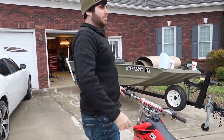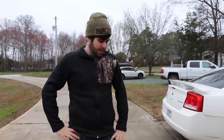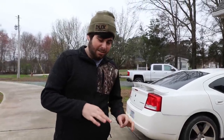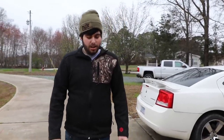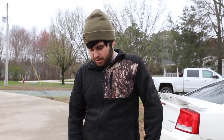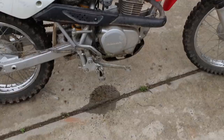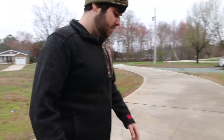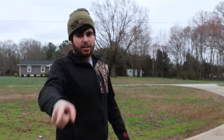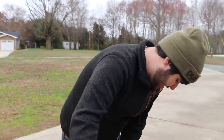Kind of smashed my fingers with my knee. We gotta go get an air filter — it actually started and was running so good. I don't want to run it without an air filter. The motor's solid. There's a little bit of chain tick and slap, but it's not smoking. After you first start it, not much smoke. First kick, the top end's pretty good. We got a little bit of a gas float stuck — that might be one of the reasons it's bogging. We need to clean the carb again, but let's go get an air filter.